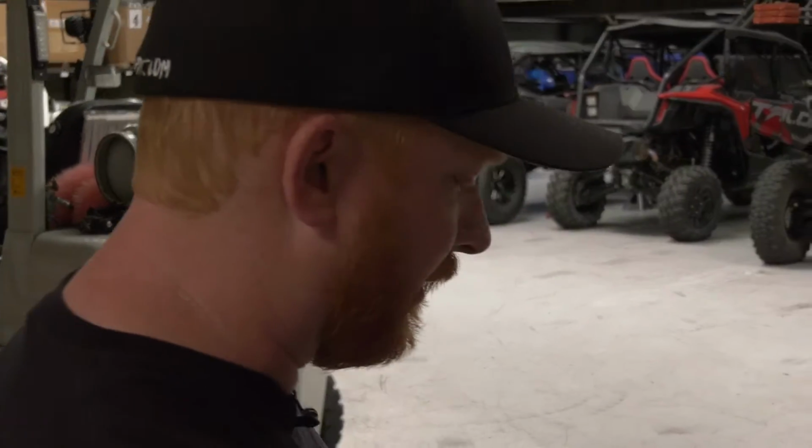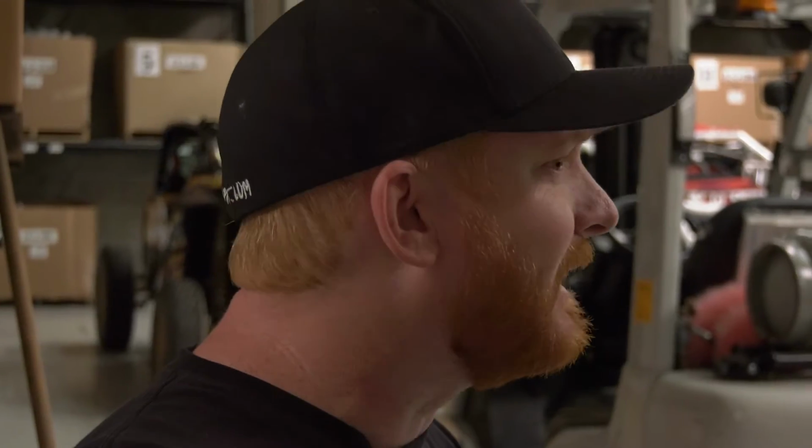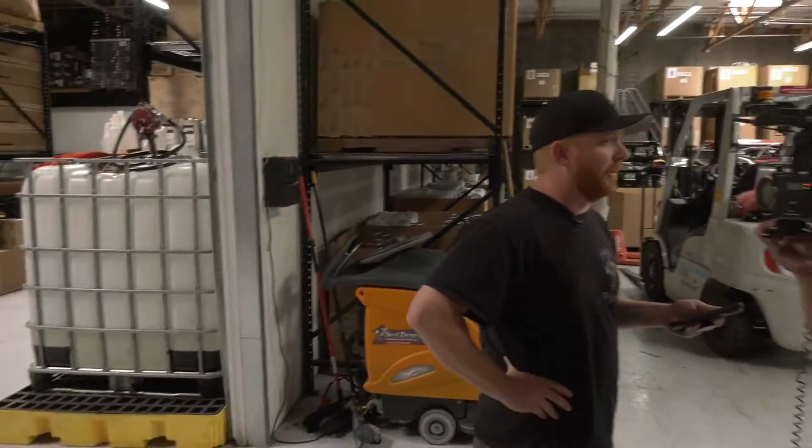Casey Jones found a missing O-ring on one of his silent crossovers. Is it okay to continue riding? Absolutely. It is absolutely okay to continue riding. We get that question a lot. You might get a little bit of noise out of that crossover when it transfers. And then, down the road, you can either pull your springs off and throw a new O-ring on it, or when shocks are here and getting rebuilt, that is part of the process that we do no matter what. So do not ever fear driving a car if you lose the O-ring for the crossover.